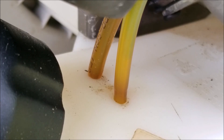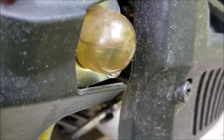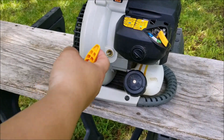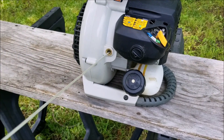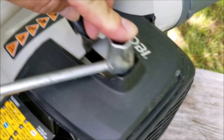The next thing I want to do is check the engine's compression. I'm going to slowly pull on the rope and feel how much the engine is fighting back. This one is fighting back but it's not as strong as I was hoping for, but it should be enough to run. I want to get a better feel for how much the engine is worn down, and for that I'm going to use a compression tester.